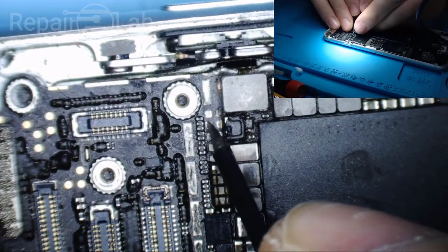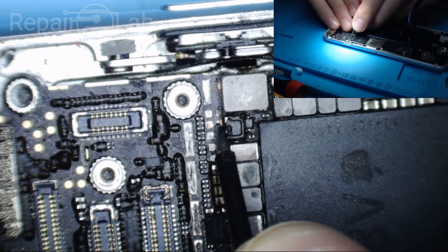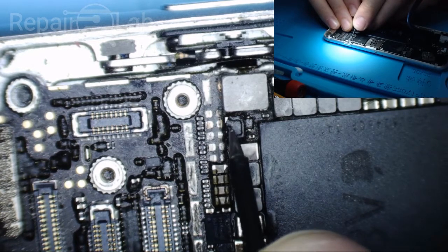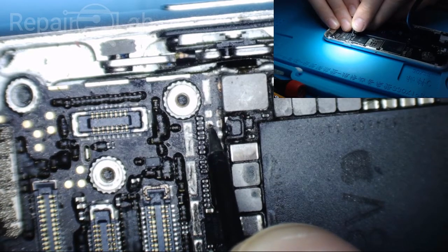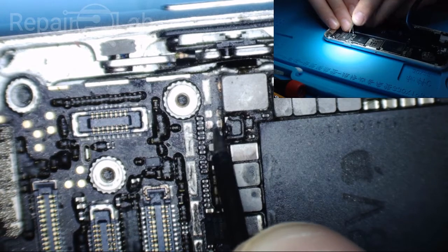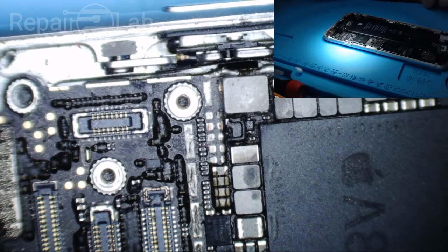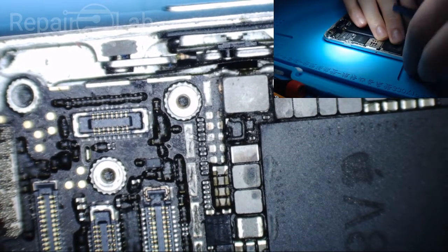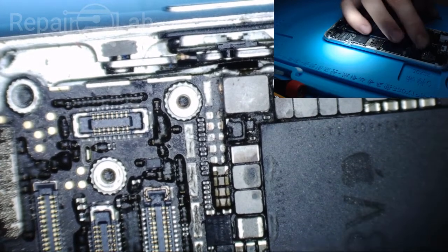Let me show you — this is the VCC main cap. It's the input of the backlight circuit over here. And as you can see, there's attenuation as well — it dips on both sides. That being said, we are dealing with a VCC main short in the first place, and we are probably going to have to troubleshoot backlight issues as well.